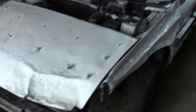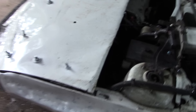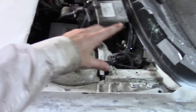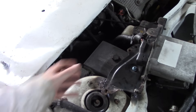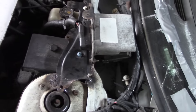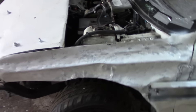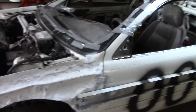I was going to start this car up for you guys today and drive it out into the sunshine to show you everything else around it, but unfortunately some stupid person — being me — forgot that when he relocated all the wires, he did not extend the battery cables yet. This still has the original battery cables under the hood, and if you put the battery in the original spot right down here, the new battery cables do not reach anymore because I moved the computer and harness closer to the firewall. So this thing will start up and we'll do a test drive later on once I get some extensions for my battery cables to run to the interior of the car.